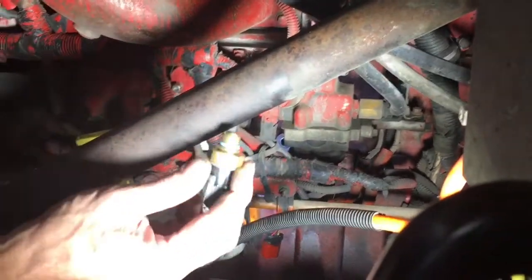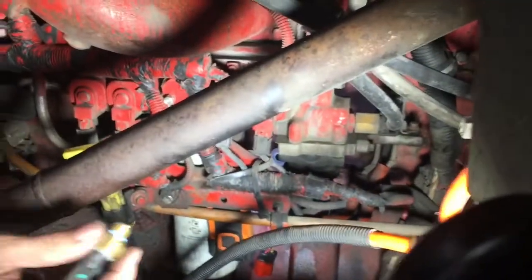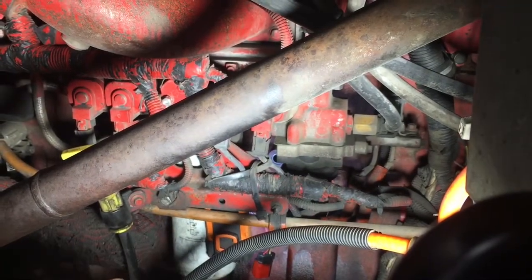This sensor has got an O-ring on it, so there's no need for any Teflon tape. Screw it in until it bottoms out — don't over-torque it. If you break it off, you'll have a really hard time getting the broken part back out.